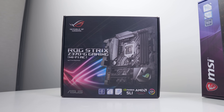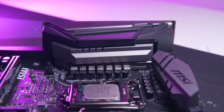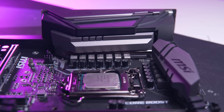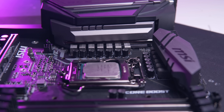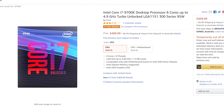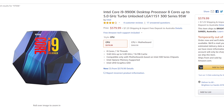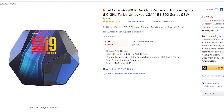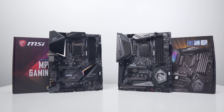Another upgrade for Z390 is that generally — depending on the board — the VCore VRM has been updated with a higher phase count or total MOSFET count to better dissipate heat and handle total power output. This is to handle the new eight-core CPUs like the 9700K, but more specifically the 9900K, which will definitely require a lot more power, especially if you're planning to overclock across all eight cores.